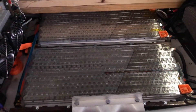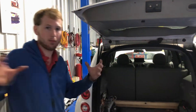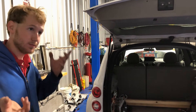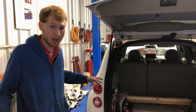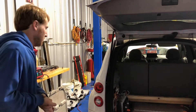I also put some blowers behind the wood paneling — you can't quite see them, but they do push air down into the battery cavity. This is a battery cavity where I took the trunk floor out and dropped the batteries in on a rack setup, three and three. This is a unibody car, so the battery rack is bolted to the structural frame of the car. There's no subframe in the back, so it just bolts to the car body, covered with plastic sheathing that weatherproofs it and sealed around the edges.